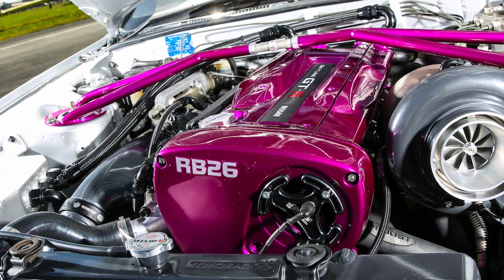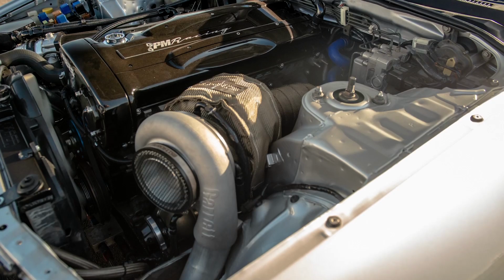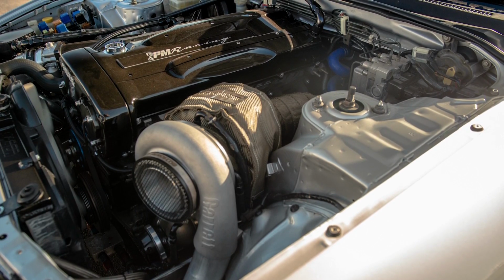Now, as turbochargers get bigger, the compressor and exhaust wheels get bigger, which makes them heavier for the same style of turbo, and they simply need more exhaust gas energy to spin them and make them work. Basically, if the engine stays the same and the turbo gets bigger, most of the time the boost curve will just move further up the RPM range.